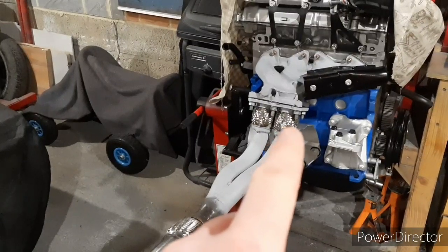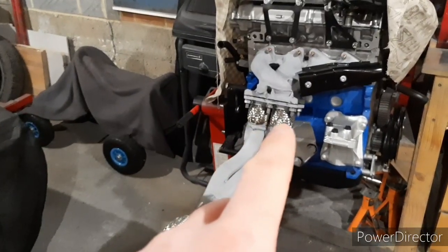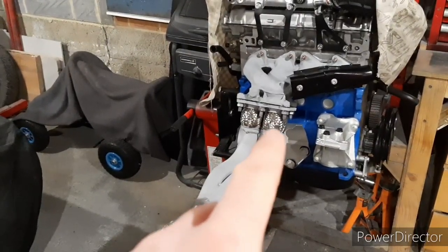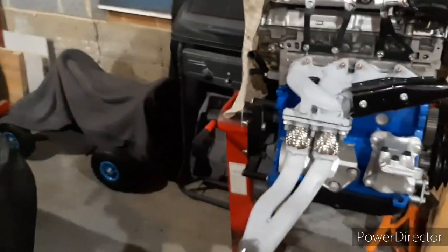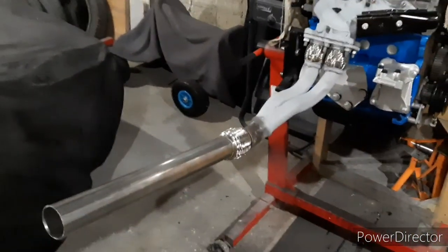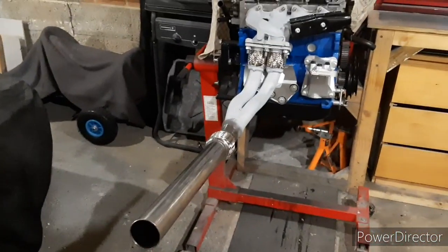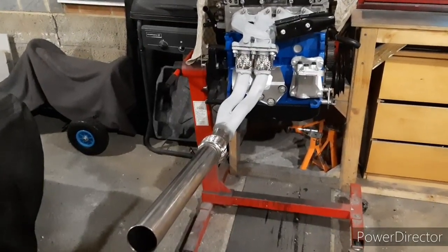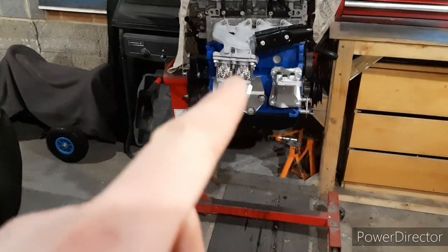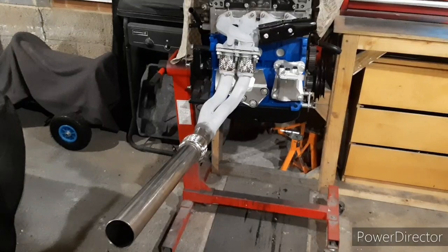So all I've done is took the standard flexi coupling off, because if you see one of the previous videos again, the exhaust comes out, it drops down, I think it's 35 mil, it drops down to the inside of there, and then it opens back up. So that restriction's gone. Nice flexes on there, so it's got a bit of strength in there. Onto that downpipe, I put another flex in there just so it's a nice flow. I don't want any strain on the system, and then that should flow as good as you're going to get, really. The cost of it is pennies compared to a 4 branch, and it's got the OEM look, bar obviously those bits, but you're not really going to see all that. Yes, it's welding consumables, but if you've got those, you've got those. So let's get on welding this.